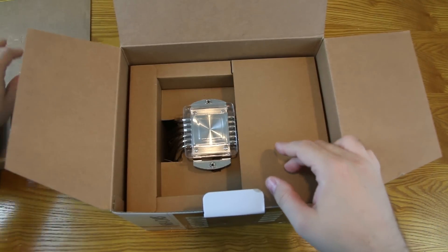Now we have actually installed the cooler itself and, as you can see, it most definitely blocks the PCI Express slot on an ITX board. Here's what it looks like without the fan, and with the fan I'm still going to clear the memory, which is nice. The fan is going to be sucking air upward, carrying some of the heat from the memory up into the cooling block and allowing that to dissipate. You can also install a second fan in a push-pull configuration — pulling air up from the bottom and pushing it out through the top for premium performance if you had an overclockable chip in a small micro ATX case.